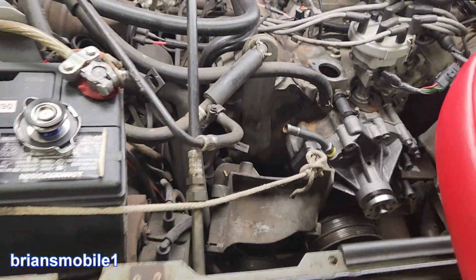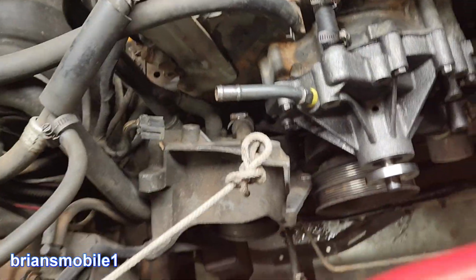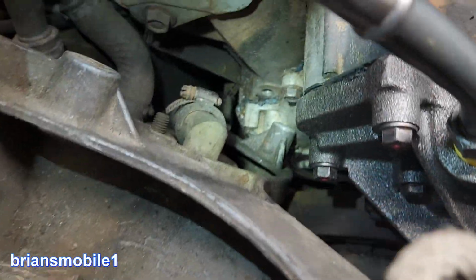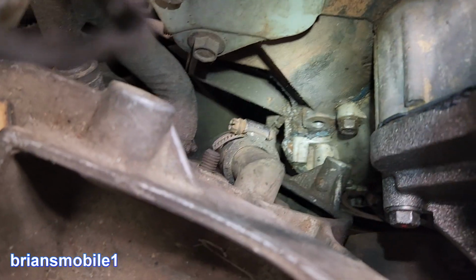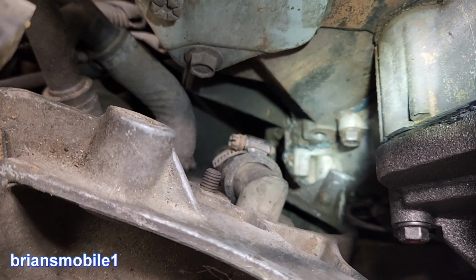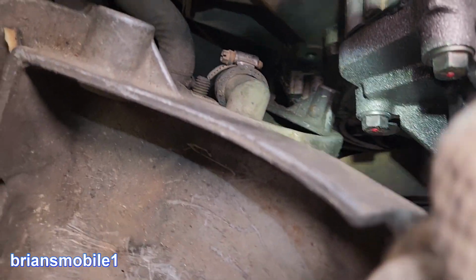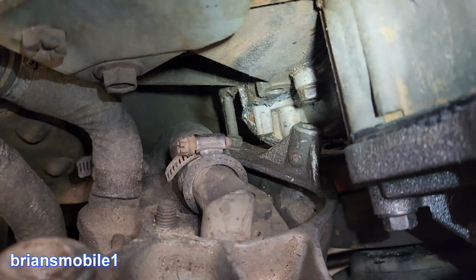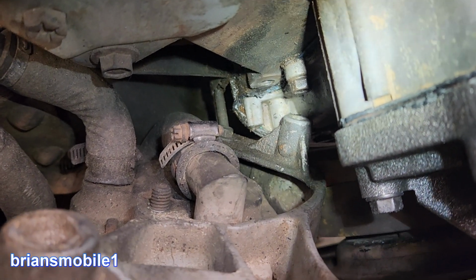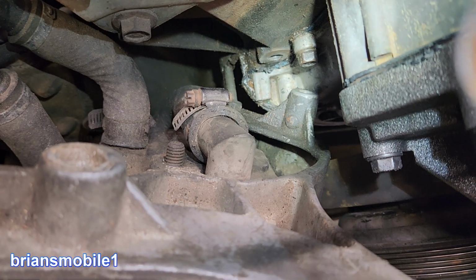There's one other thing I would like to add to this that has been a stumbling block for other mechanics on this one, is that bolt hole down at the bottom corner. So you can see the bolt hole right there. Somebody put a long bolt in that and caused a leak, but it's a little bit tricky one to get, because you can see where the air pump is down here. So you've got that little part that sticks out, and see how far down in you need to get. The bolt head starts past the end of the pump right there.